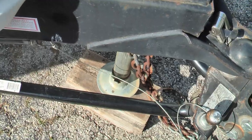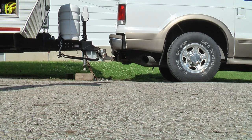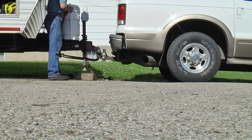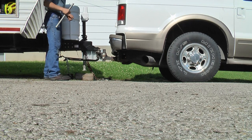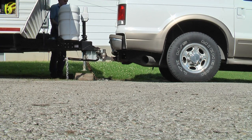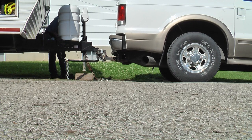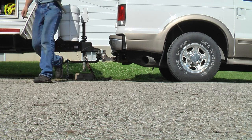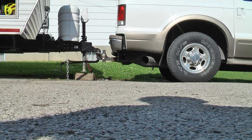It'll sag a little bit — not tremendously, but reasonably, it's visible. Watch the truck as I take these weight distribution bars off. The majority of the weight is going to be on the left one because the truck's on a slope. That one didn't do much, but this other one will do a lot. It really helps level out the truck and the trailer so the truck isn't sagging. Not much of a difference, but it's there.